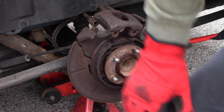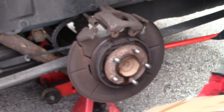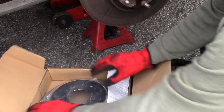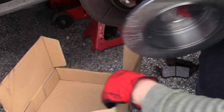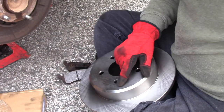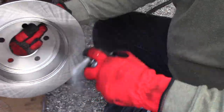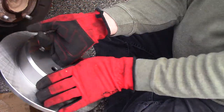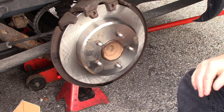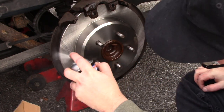We're going to get our new rotor. I just got this rotor at AutoZone — it's part number 5383, a Duralast. It comes with a three-year warranty. It's not their Duralast premium, just Duralast. When you take your rotor out of the box, it's usually wrapped in plastic and it'll have a coating of oil on it. What you want to do is get yourself some carburetor cleaner and spray it down to get the oil off. Carburetor cleaner comes out very fast.